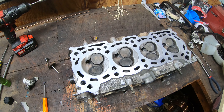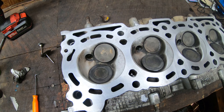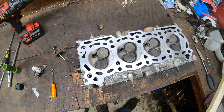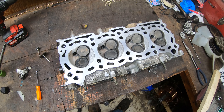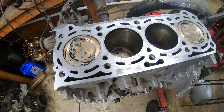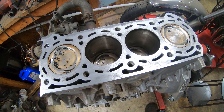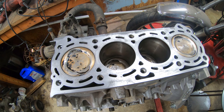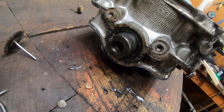The only thing I found that seemed like a major issue is on this one valve that's poked out — there's a pretty good bit of play. I'm wondering if that valve guide is shot, and if it is, who's to say the others wouldn't be too. Valves are coming out next to check that out, take some measurements, and compare to the specified clearances to see if it needs new valve guides. I've never been into one of these motors before. The block cleaned up fairly well, but even before sanding it felt gritty down in the cylinder, so those pistons will probably come out, get a light hone and re-ring, and we'll check dimensions on the pistons and bore to see if it's out of round.